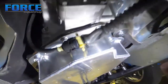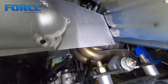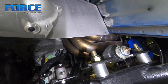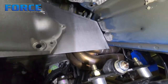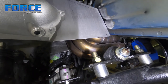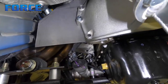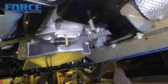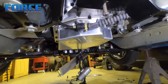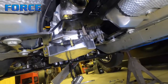I got this thing sitting in place. The trans mount is pretty nice. Looking at the block plate, you can see where I got it prepped. The next thing I'm going to do is put the tabs up there, put a couple tack welds on them — clamp the tabs to the plate, and then I might just weld them in place with the trans in here, then pull it out to finish the back side. This thing went in really well. The 6R80 is pretty tall in comparison, but the pan on the TH400 is really wide so I was a little worried, but it fits no problem.